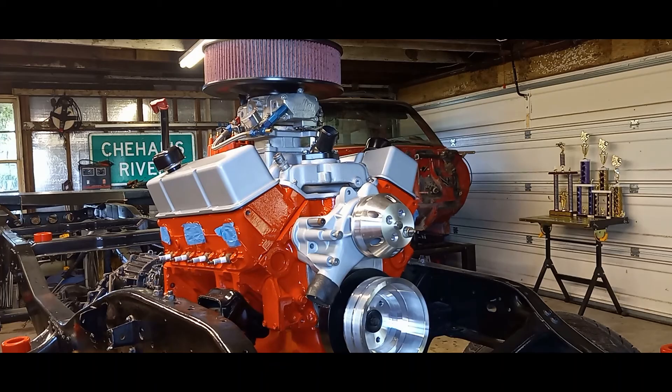The only downfall is the Dart heads on the exhaust seat have about a 125 thousandths ledge that makes the exhaust port measure 1.220, which is actually only 76% of the valve diameter — which is rather bad. Just taking that 125 thousandths ledge out and blending the valve job makes a huge difference, and you don't have to be a pro. You just need the right tools, a little competence, know how to set up valve springs and valve spring height afterwards, and be careful not to hit the valve seat. You could also get rid of the cast finish in the exhaust port and smooth it out — just don't remove a bunch of material if you don't know what you're doing. On the intake you can do a couple simple things like open up the throat a little — 86% to 91%, with 91% being about as far as you want to go. Clean up the port, leave it in a 80-grit cartridge roll finish. If you have a set of old valves, you can unshroud the valves, clean up the chambers, get rid of sharp edges, and smooth the chambers out nice. When you're all done, you have a head that can easily support 450 horsepower from these simple mods without even having a flow bench.